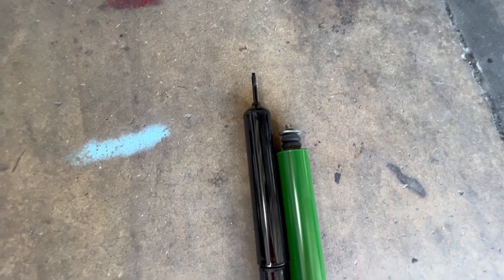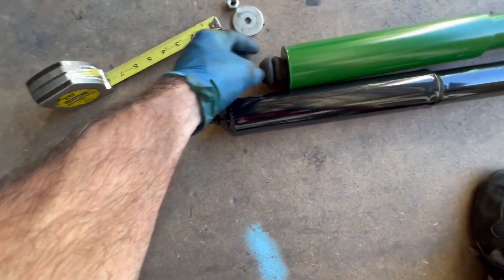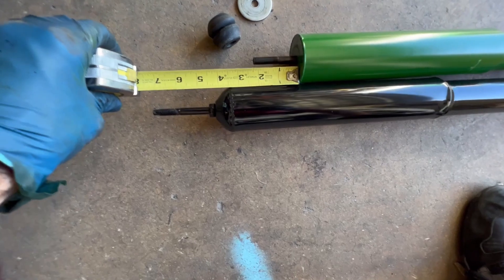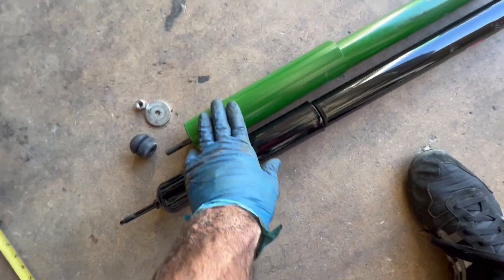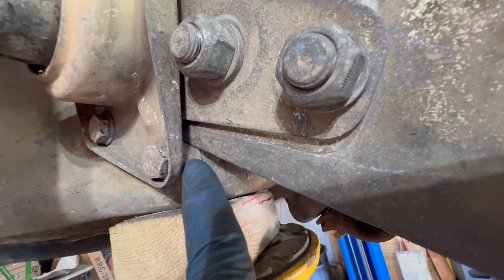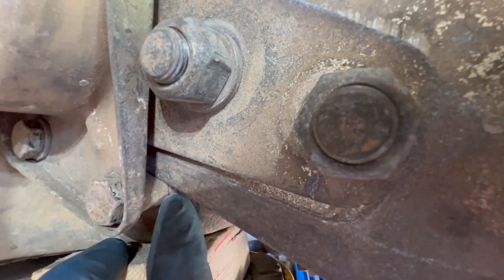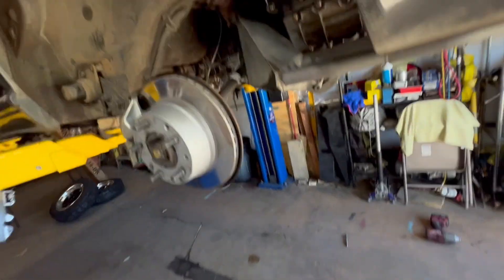You can see the difference in the length of the shocks. Measuring from here to here, it's about four and a half inches - so this new shock is about four and a half inches longer than the original. More importantly, this one has a much longer stroke. The downward travel is also limited by this little stop piece, which limits how far the spring plate can go, so the extra length should more than compensate for the additional lift.